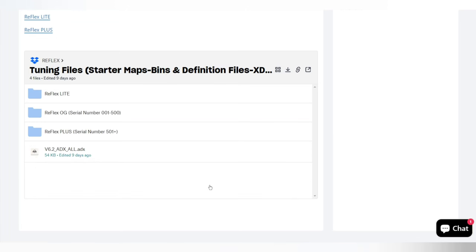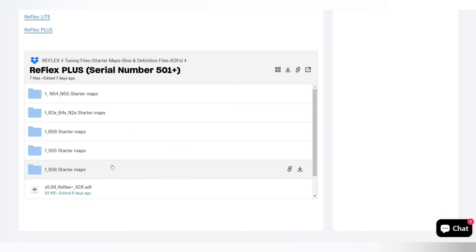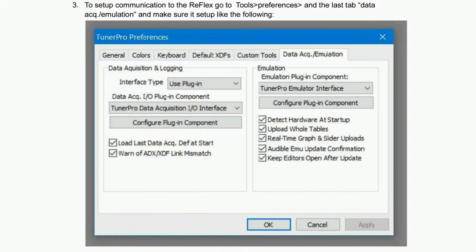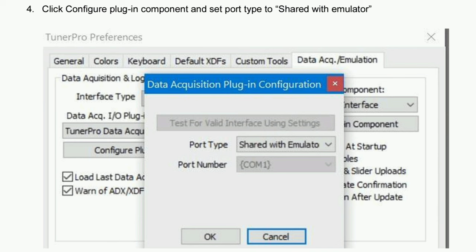You're going to need three files. The ADX file and the XDF file can be found on Motive's website — go to their Dropbox and to the Tuning Files folder. You want the latest XDF file and ADX file for your specific engine and platform. Once you get those opened up in TunerPro, they'll always be linked, so you really only need to set it up once. After that, you'll also need your BIN file, and that is the file from your tuner that has all the flash data on how your Reflex should work. Every revision, you will upload the new BIN file but leave the XDF and ADX files the same. Make sure you follow the initial setup guide in the Motive Reflex documentation to check all the required boxes in TunerPro configuration.